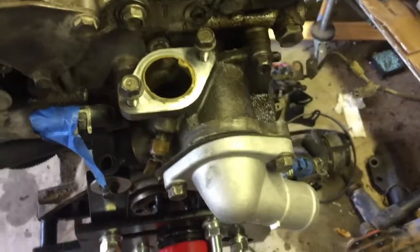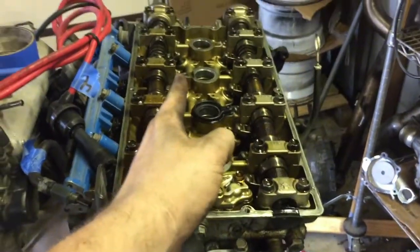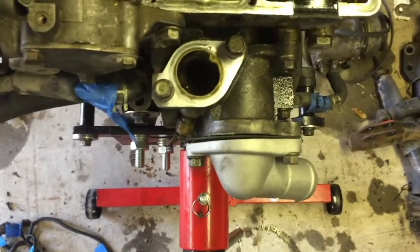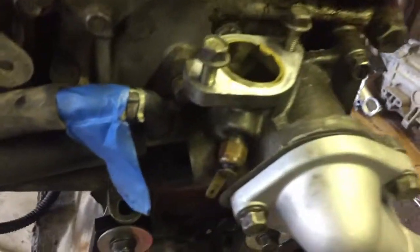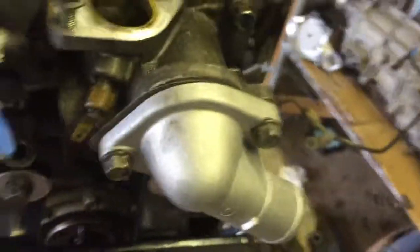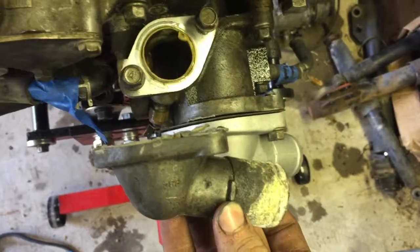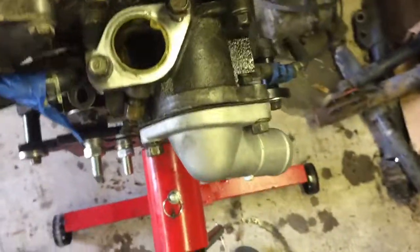As far as the water outlets go, where it was sideways in the car is now going to be facing front in the truck, so this will be against the firewall. I'm gonna have to trim the firewall some, but less is better. This is off a 1.8 Mitsubishi — it fits up perfectly, whereas before there was an angle difference. It points out less, so that'll help me.